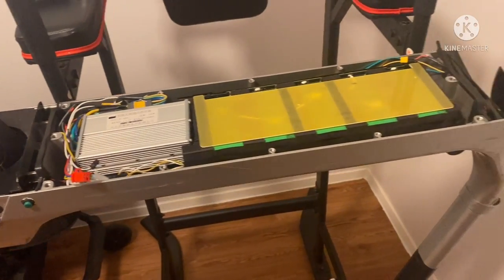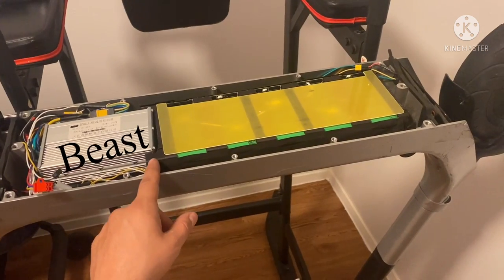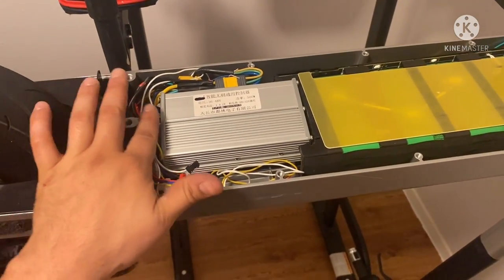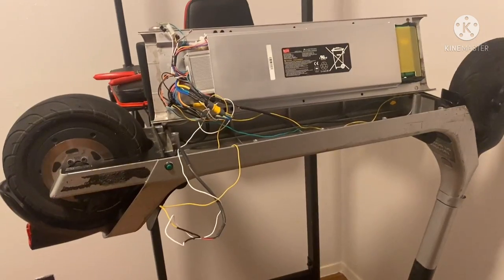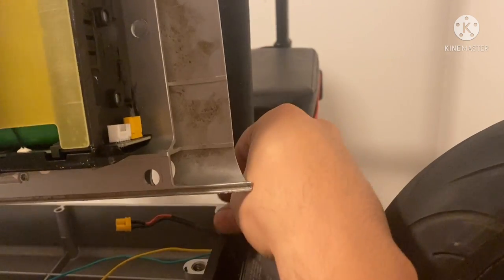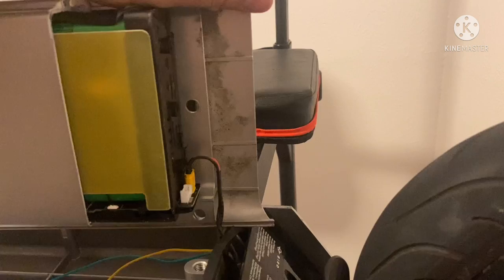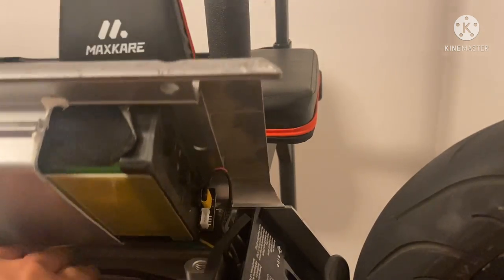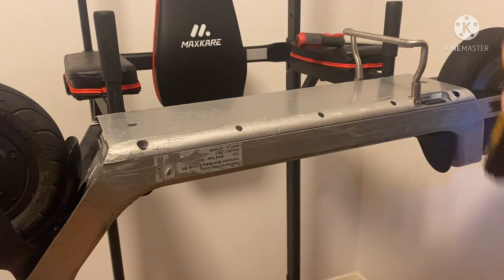Let me show you all the space you have to deal with on this Bird 3 scooter. This is only with the 500 watt — you can see how I modified the battery housing where I cut it. All your wires are going to have to lay along this side. Be careful not to be over the screw or else you will break your wire and cause a short. Now let's go ahead and close our housing up. My controller goes on the back end. Before we do anything, we want to connect our charging port, which goes to this yellow tab — you want this connected so your scooter can charge. If this is not connected, your scooter will not charge. Now I'm going to flip the scooter around and get our wires situated. I have the three screws in, the center one in, and these last two to put in — then I'll step my scooter up and work on my headlight from up top.